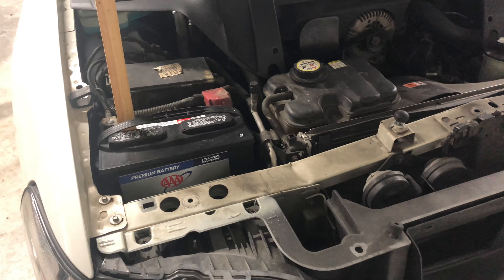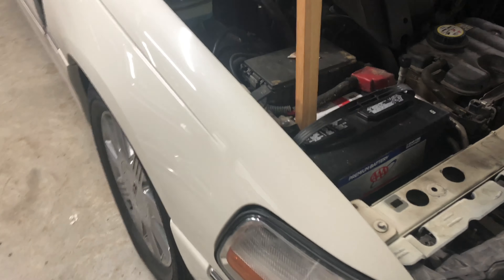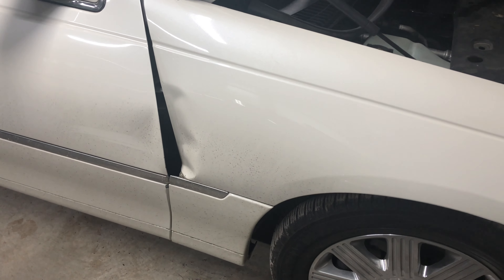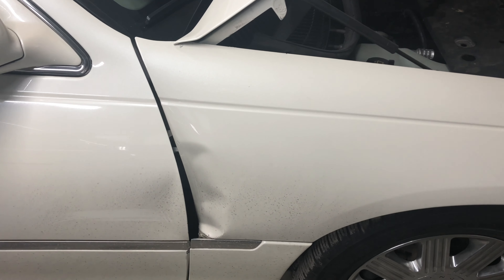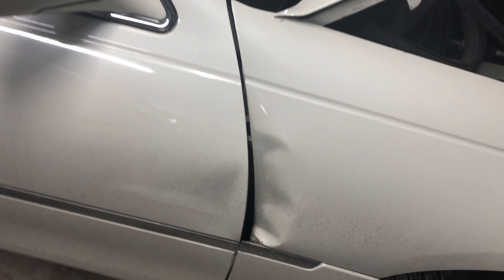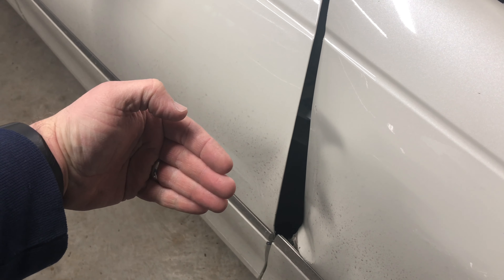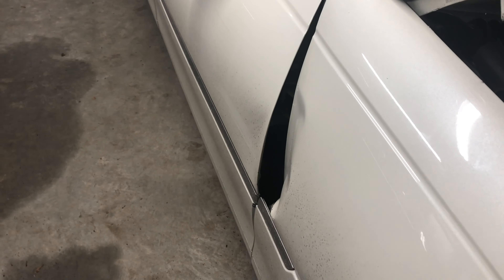Even the right side, which doesn't look too bad until you see that the headlight is not flush with the fender - it's actually sticking out because it's been pushed over so hard. I'm assuming that when she tried to get out of the vehicle she couldn't get out on the driver's side, or maybe someone was trying to help her out from the passenger side - either way, this fender has got a big dent in it. These things are so cheap to find at U-Pull-and-Pay yards, it just makes sense to get a new fender. The hood is overlapping the fender at the top, which means we probably need hinges too. The edge of the door right there has got a dent in it and I may be able to push that back flat from the inside.